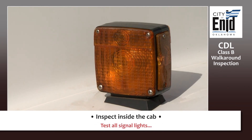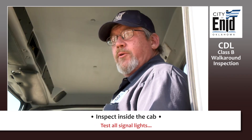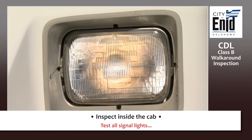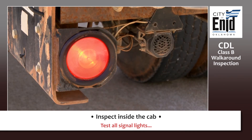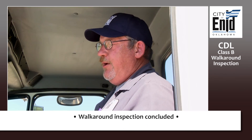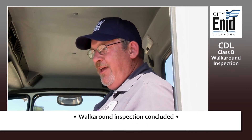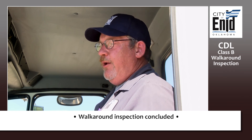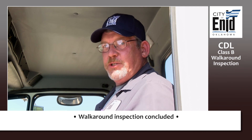At this point, test all of your turn signals, your emergency flashers, your headlights, tail lights — and your DOT examiner will help you perform that test. Once that's done, you can look at your instructor and the evaluator and say, 'This concludes my walk-around inspection.'